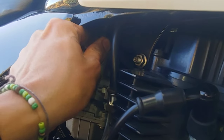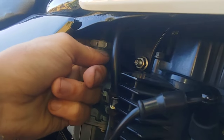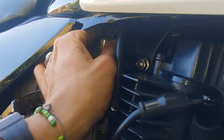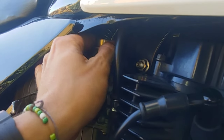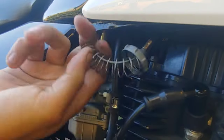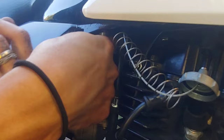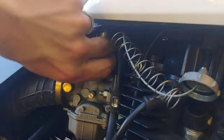The first thing I do is unscrew the cover for the throttle slide. This cover keeps pressure on a spring which is used to push the throttle slide back down. The next task is to pull the throttle slide out from the carburetor body — it's not so easy because it's stuck up against the tank.